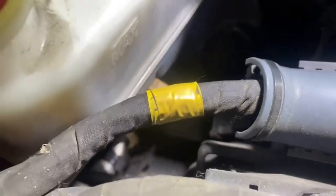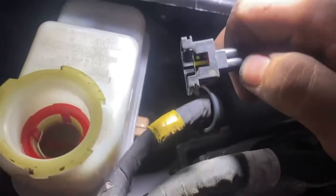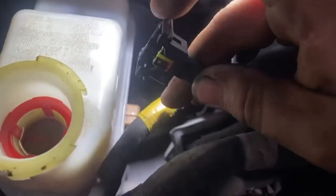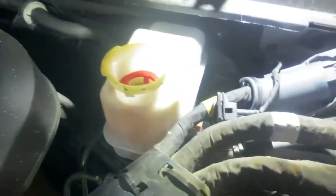You're gonna have to flush your brakes afterwards - I'm not going to show you guys how to do that in this video but there are plenty of videos on how. We're gonna get that bolt and washer off that stud, and that bolt and washer off that stud. You're gonna have a connector here - this is the clip I was talking about, it goes over this and holds it in right here to your level sensor. Take your lines out first, then it should pull back and you should be able to fish it out.